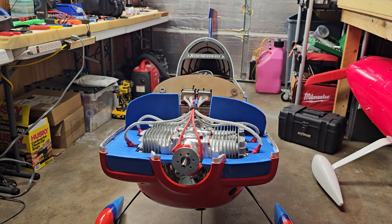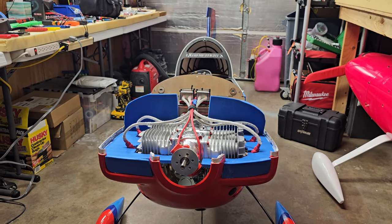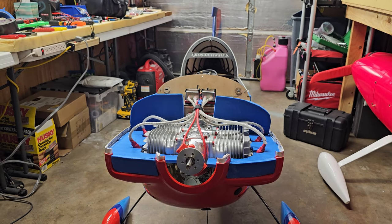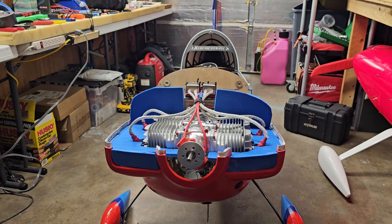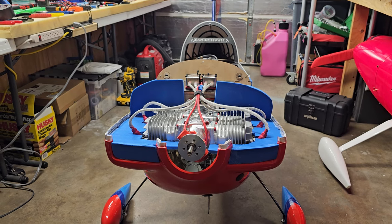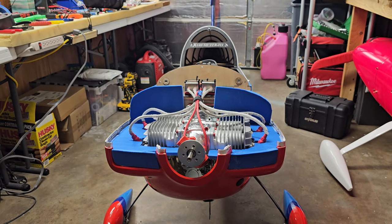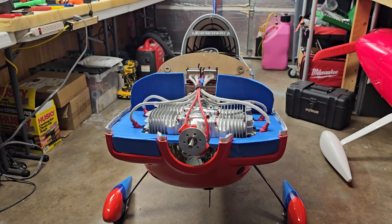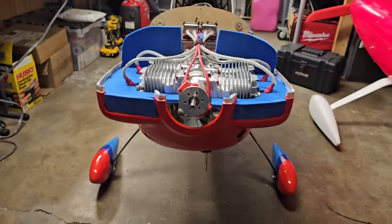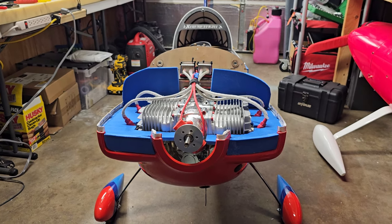It had also cooled down by then — down to 100 degrees at the hottest point when I shot it. After the second flight I tried to start it again and couldn't get it to start at all. Either it's got some weird thing where it doesn't like to start warm, or the low needles are a little lean, or it's all that choke thing. I'm just going to assume it's the choke thing. I've got a second choke arm on there now, so I'll close both chokes.